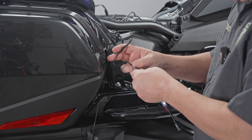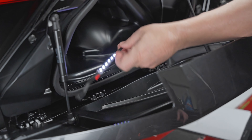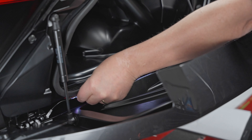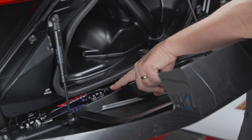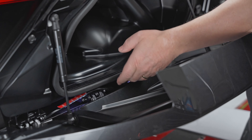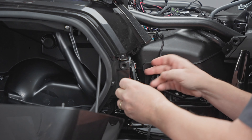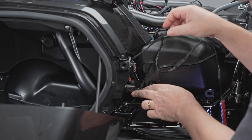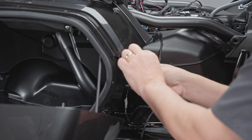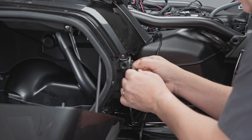Next, all we've got to do is open the saddlebag and install these. We've got our two LED strips attached to the 20-inch. Just like we did on the other side, we're going to put them underneath here, making sure the wiring goes over the top of that hinge on each side. I've wiped this off, so we're going to peel this off and install them. On this side, tie this off right here so the wire comes in behind — but don't get too tight because you have your heated seat to deal with. Just get it snugged up so the wire has enough room to move and stays out of the way.